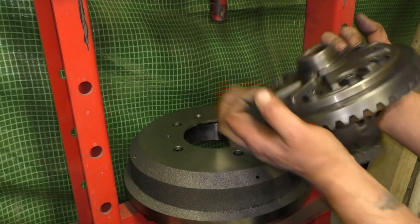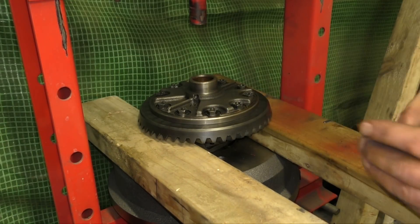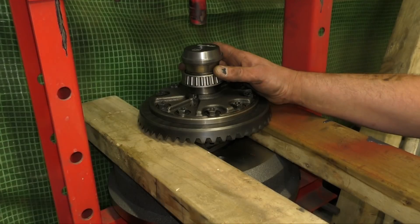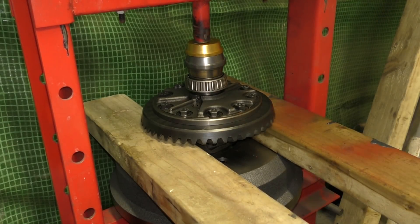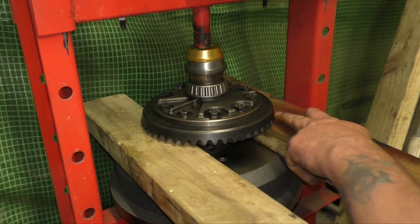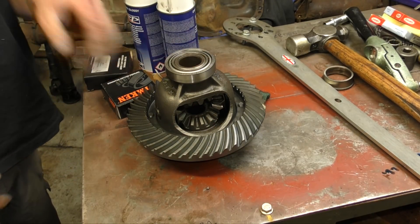What we have an issue with, unless you've got something that fits exactly, is we don't want to damage any of the parts by pushing it into the brake drum — so we'll use some wood, nice and soft. Then we'll go ahead and fit the bearing the right way around. Bearings only go on one way and it's pretty obvious. Stack them up and push them into place until they stop. Check that the bearing carrier is not damaged — if it is, you'll have to put another set of bearings in because you do not want it distorted in any way. Keep the races together and make sure you don't get dust and grit on them, then we'll be ready to assemble this into the housing.